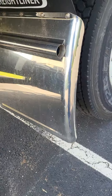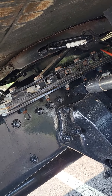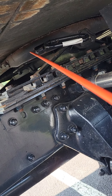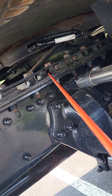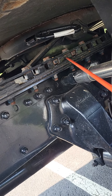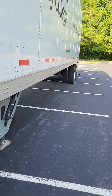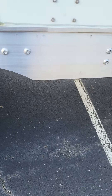We're going to come up here and talk about our sliding fifth wheel rail — that's this rail right here, and it allows the fifth wheel to move. Our sliding fifth wheel rail is not bent, broken, or cracked — not missing any nuts, bolts, or screws. We have locking pins — three of them. They are in the locked position, and they are also in the proper position so that the rear of the tractor does not come in contact with the landing gear in turns. You must say that.